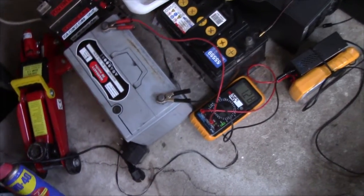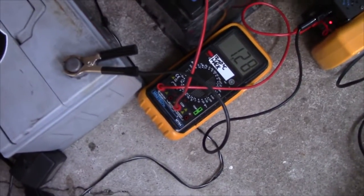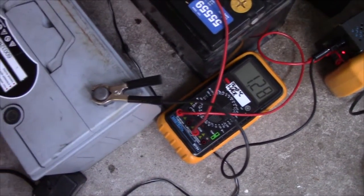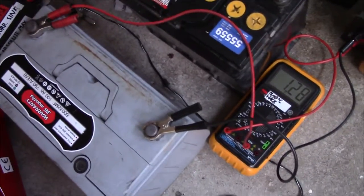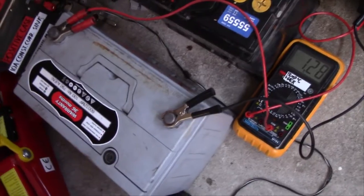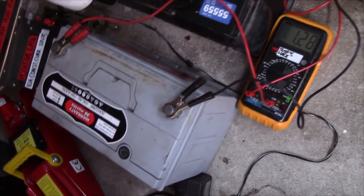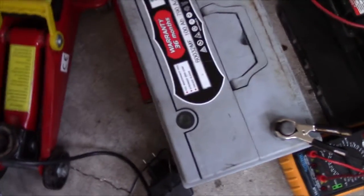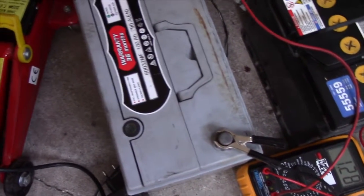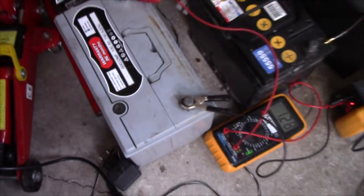And the little guy is doing well for himself. Steadily dropping in current, almost down to the rule of thumb, 1% of the 20 hour capacity charge current. So this could be a decent one, but no caps, can't refill it. Gonna have to hope that it hasn't all boiled away.